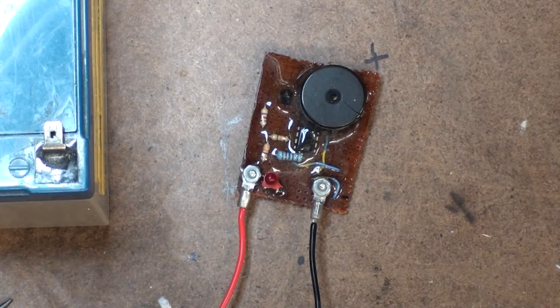So any of my flooded lead acid batteries that I have on a charger in my house — I've since got much better trickle chargers, or battery maintainers, that don't constantly supply voltage. Basically they monitor the voltage, and when it gets below a certain amount they start charging again. Which is a lot better than a constant trickle charge or even a float charge, because if you get the wrong one, you'll boil your battery dry.